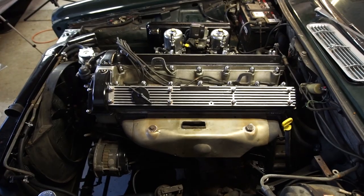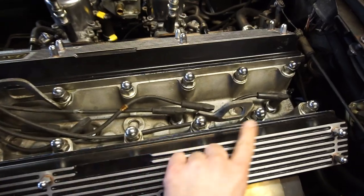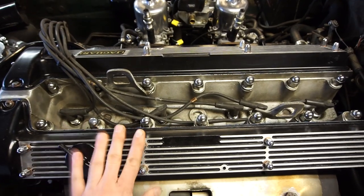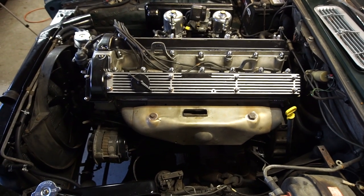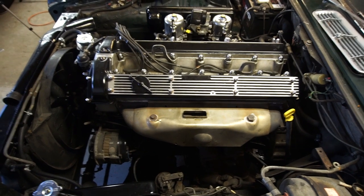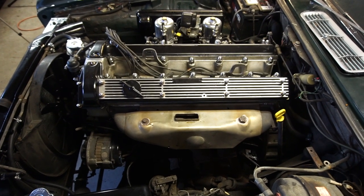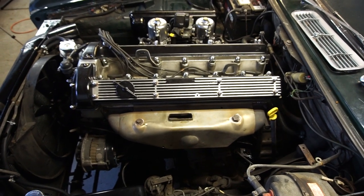After I turned the camera off, I ran the engine for another 10 minutes idling in the workshop and the coolant leak stopped — so that's really great. I'm still going to re-torque the head, but I'll do that after a test drive. It runs and I'm really happy about that. Now I can drain out the thin oil I used to flush the engine and pour in some nice 20w50 Castrol Classic, put on a new oil filter, and then start tuning.